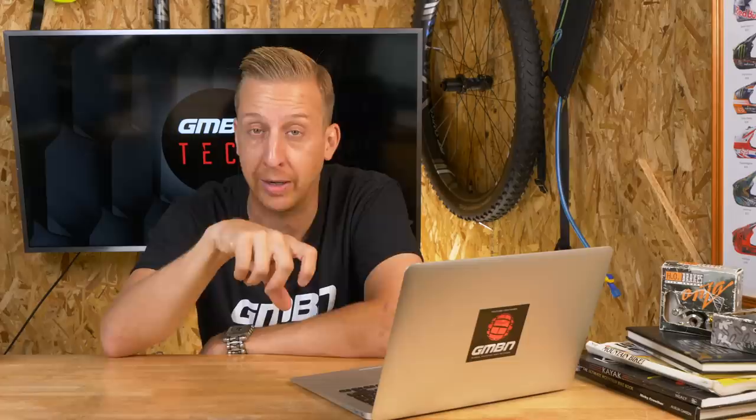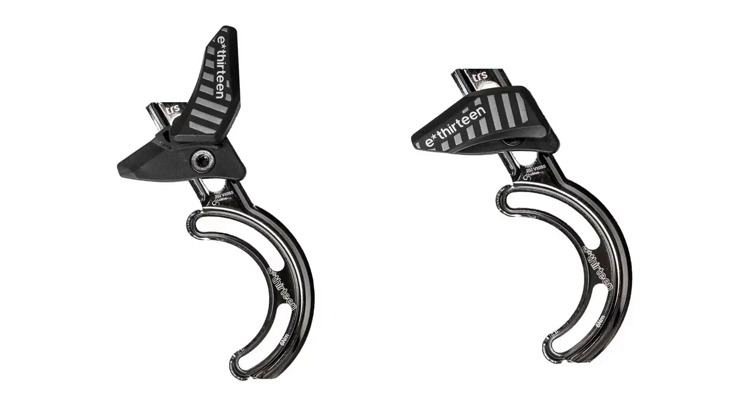So you do have a couple of options. When you change to a single crank and new bottom bracket — which is a very good upgrade — I wouldn't focus so much on getting a narrow-wide chainring alone. You're going to need some kind of compact chain guide, just a minimal upper one. MRP make one, and there are various fittings — front mech mount, round the seat tube, ISCG mounts, or the bottom bracket shell. E13 also make one, and they're both very good for the money. Long before the current one-by-11 and one-by-12 phase, I used to run one-by-eight and one-by-nine using one of those MRP guides, way before clutch mechs and narrow-wide chainrings. You don't have to buy a new derailleur or shifter — just go one-by and get that compact chain guide on top. I think it will make your bike quieter and you will love it.